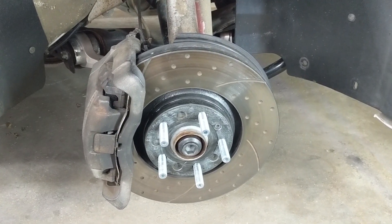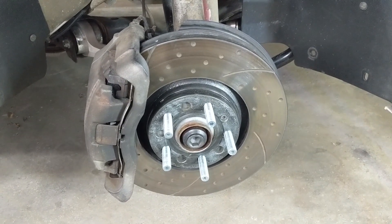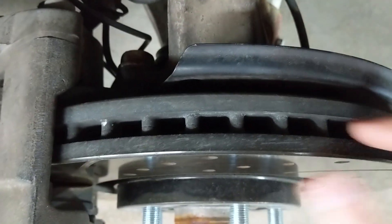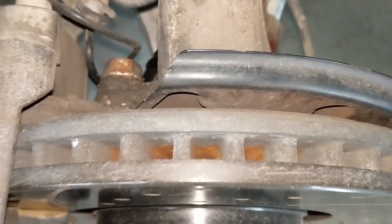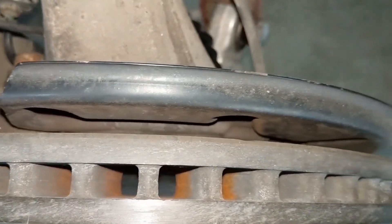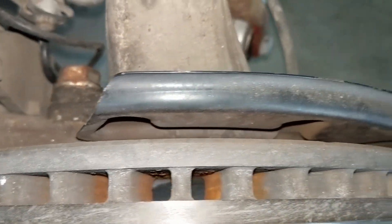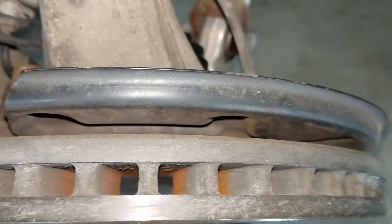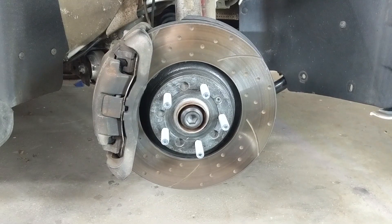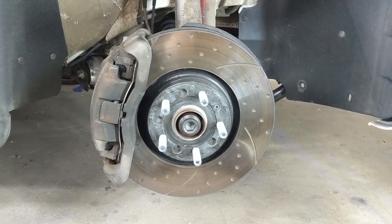The first factor is internal vein structure, and this overrides any other quality of the rotor. I'm talking not about the face but about the inside — these right here. Looking down into the rotor you can see veins that go all the way to the core where the hub is. In my case, no matter what angle I put this at, the veins go straight down towards the center. These are straight veins, and with straight veins it does not determine whether the rotor has to go on the left or right side of the car.